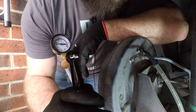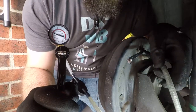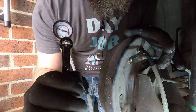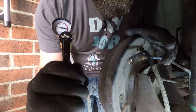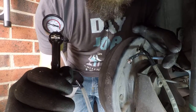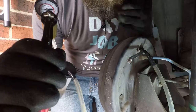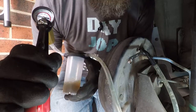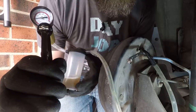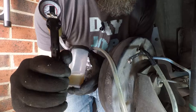Just give it a pump to keep the suction pressure there, and then all you need to do is wait until you see your new brake fluid coming through. This is why it's a good idea to try and get brake fluid that's a different colour to what you've already got in your vehicle, because you'll be able to tell as soon as that new stuff comes through. Keep an eye on the reservoir too — if you drain too much in one hit you'll risk sucking air into your brake fluid reservoir and you'll be starting all over again.